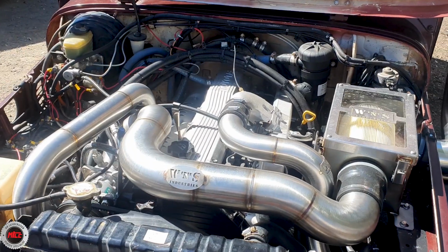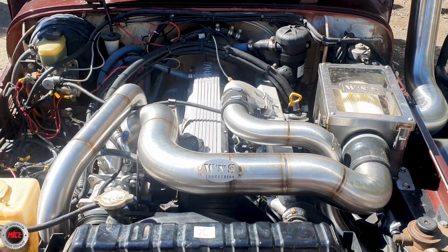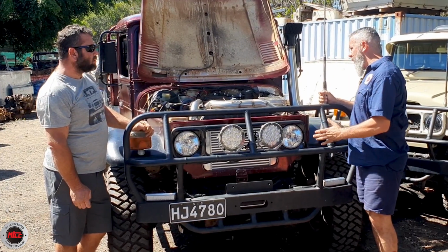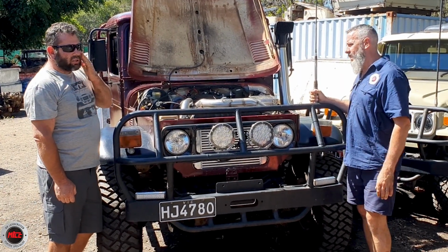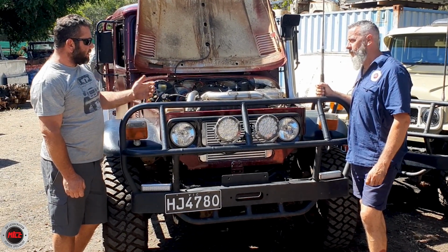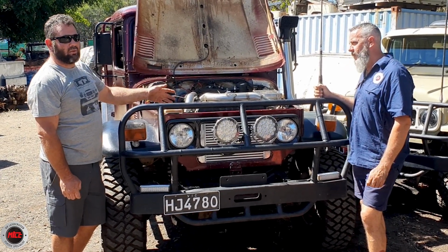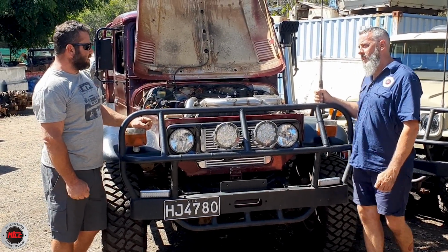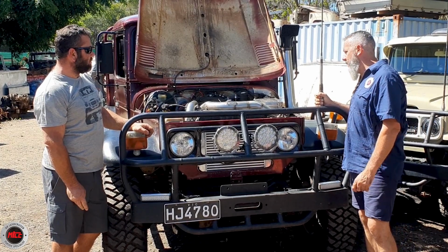And the R&D and the work that you guys and Harley at Whistle and Soot have done on this is mad, hey? So you were telling me about your EGTs. Yeah, I was getting sort of 600 EGTs coming up the hills from Victoria, and now going up the hills, I'm lucky to reach sort of 400, 450, so it's dropped the EGTs massively. That is awesome, that is mad.